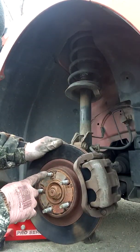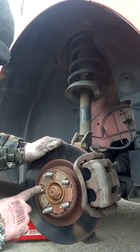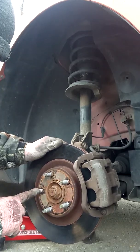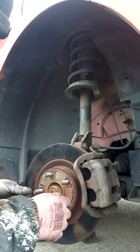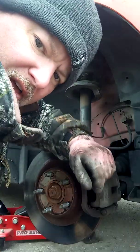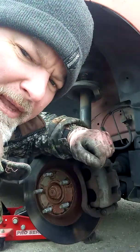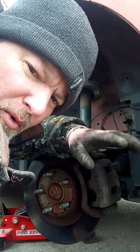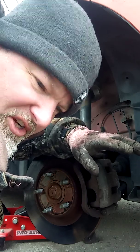The other thing I recommend, when you put the wheel on, don't tighten it going around in a circle. I like Xing things, okay? Start with this one, and then put 3 on. Put this one, but don't make it tight. Make it snug. Make this one snug and make this one snug, because with an acorn lug nut, the wheels are machined to a cone. You want to make sure that the lug nut is centering that cone so you don't get any wheel vibration or wobble. Then when you have those 3 snug, go back and tighten the 3. And then the last 2 you can put on full tight. And that'll help keep the wheel center. It'll help keep it hub-centric so you won't get any wheel tramp, you won't get any weird vibration.